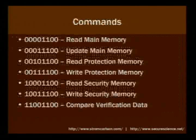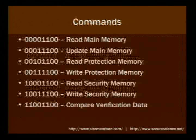So the problem is this doesn't really chop up cleanly into individual bytes, because there are a lot of things where it'll read ones while the card is processing, and the card will process and process and then say, okay, I'm done, but it won't actually be on any number divisible by 8. So you've got to manually step through this and figure out where the codes are and what's happening. You've got to have a little patience.